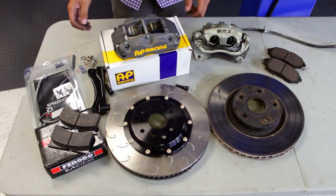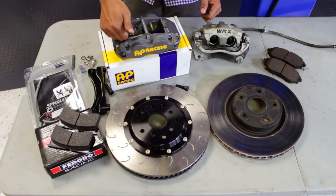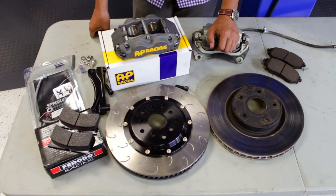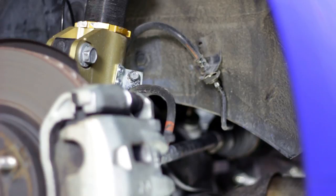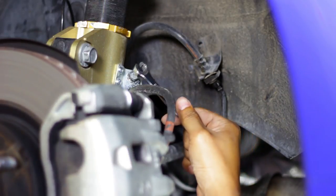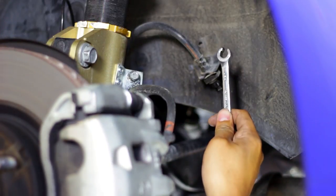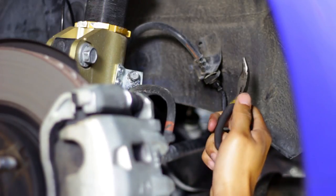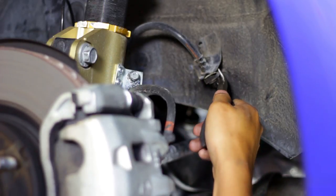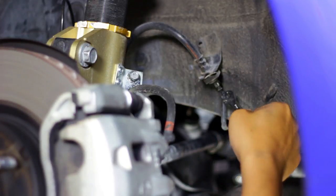So it's a great upgrade with a lot of good things about the big brake kit for those heavy duty track guys. So we'll get this installed. With the wheel taken off, we can start getting the OEM brake system off. First step is to get the brake line off the hard line and the coilover or suspension mounting point. You'll need a 10 millimeter line wrench and some type of needle-nose pliers to get the clip off. We're going to leave that clip there for now as it helps hold the brake line while we try to get it free from the hard line.